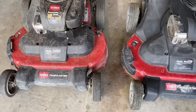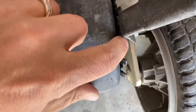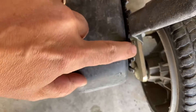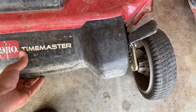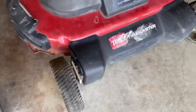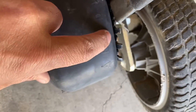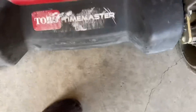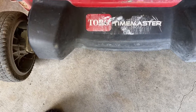We've got our two mowers sitting right side by side. Look at this detent right here — see how much wear is on it? You can tell what position it was mowed in all the time; it's got a notch wore out of it. This whole front end is pretty loosey-goosey with some wear and tear. Whereas on this one, it's got a little wear but it's not bad. The wheels on this one are solid on both sides and it seems to be a more sound machine.